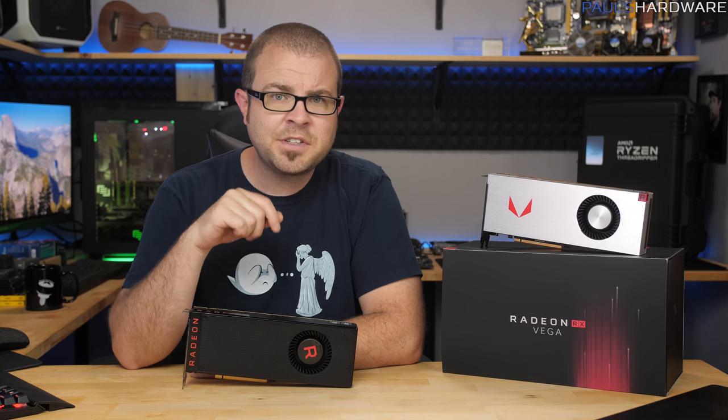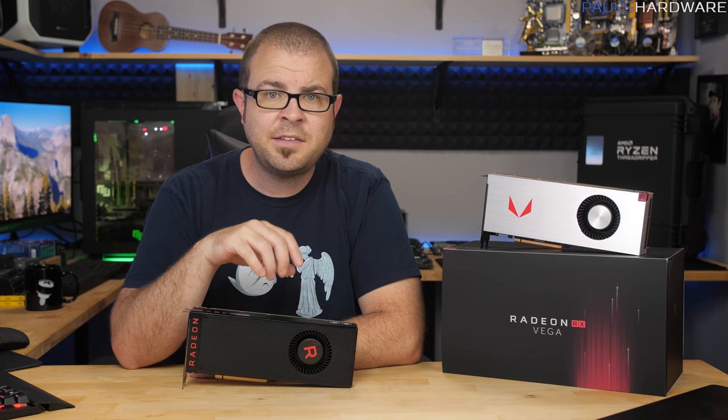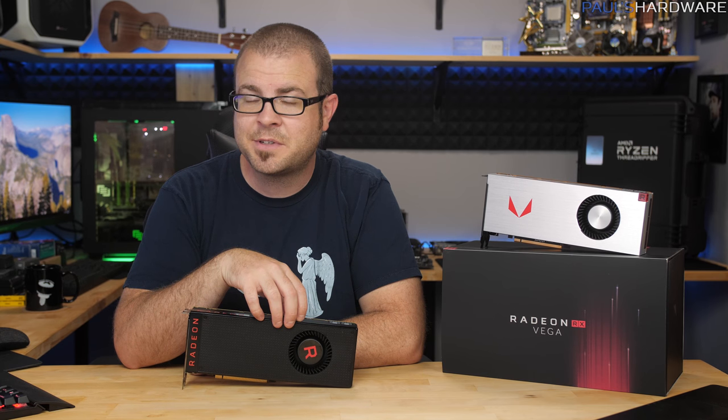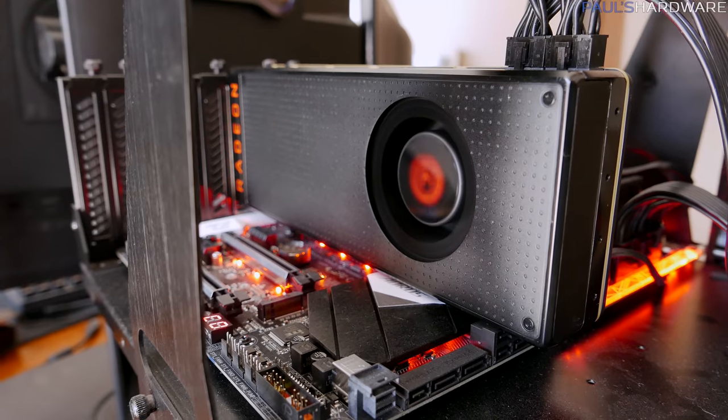Speaking of loud though, unfortunately I didn't have time to run official sound meter testing for this video, but anecdotally I can tell you that with the basic turbo setting, the fan noise for the Vega 56 was just fine, not quiet, but well within acceptable noise levels for gaming. When overclocking, however, well, a blower style fan running at 4500 RPM might as well be a small vacuum. Let's just put it that way.